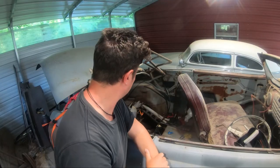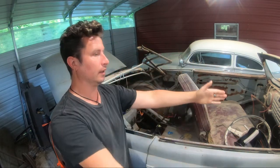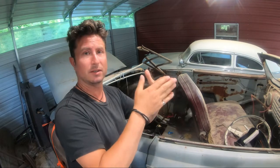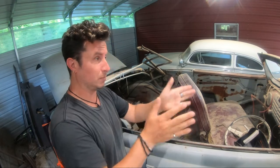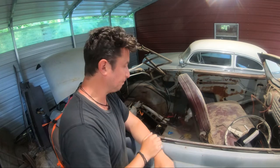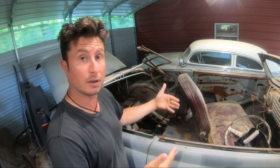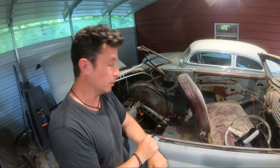It's time to start mocking up these ladder bars. Number one, they should probably be as far out on the axle as possible. Number two, the closer they are to being parallel to the frame, the more it's going to bind — we want to get as close to mounting it like a wishbone to reduce binding. Number three, even though I want them as wide as possible on the axle, I think I need to tuck them just inside of the frame rails, because as the axle goes up and down on a low car, it'd be a sad day if our ladder bars hit the frame and stopped things from working.